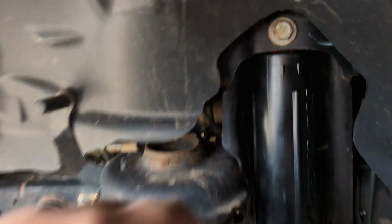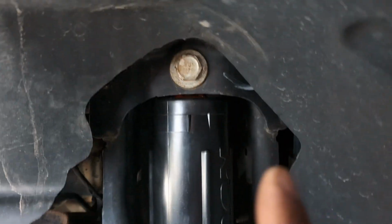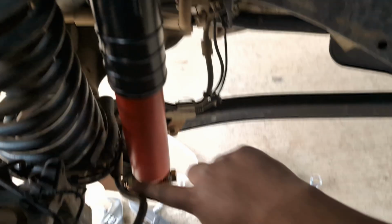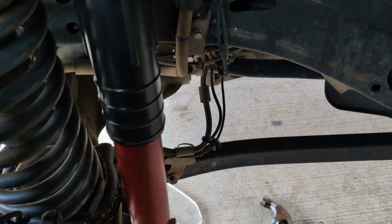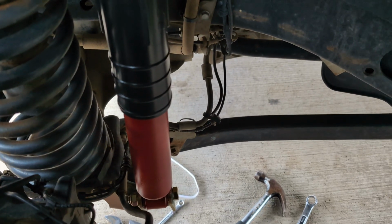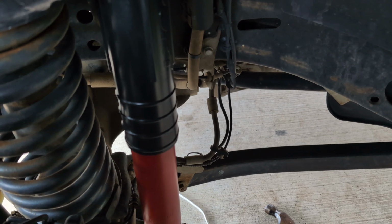Alright, so after riding the struggle bus, I went and took the top one out first, put the bottom one in, and now I'm going to tighten these. This one is 80 foot-pounds, the bottom one's 75. Also have to do the cross 175 and retighten the 14mm and the 10mm, because I was using the adjustments that are very few and far between for this. Maybe my bracket's just slightly out of whack.